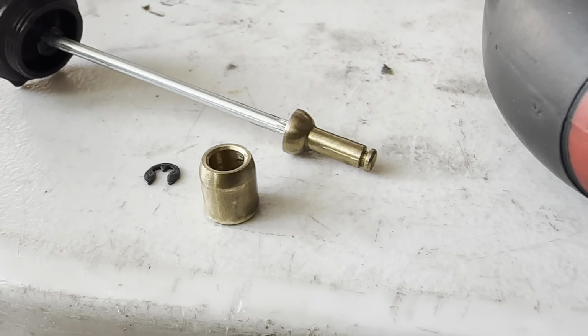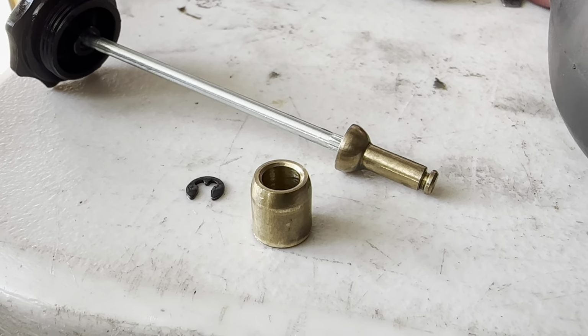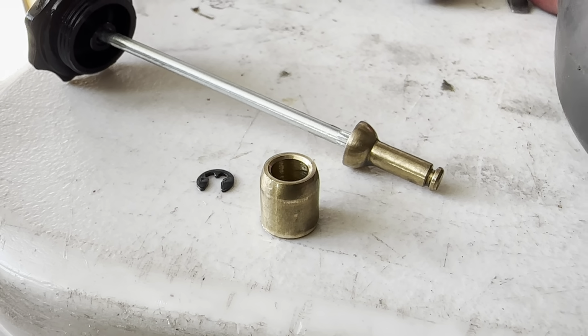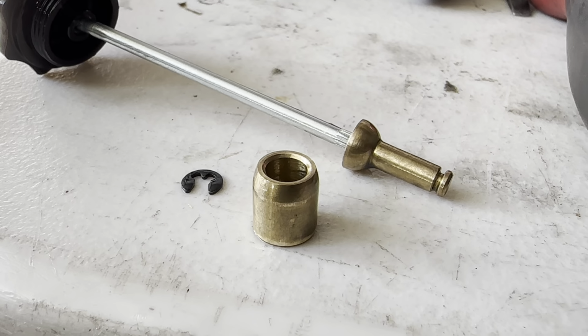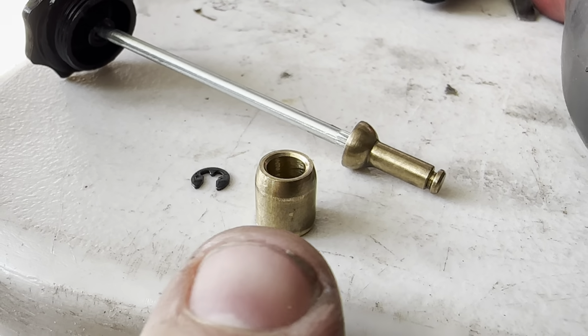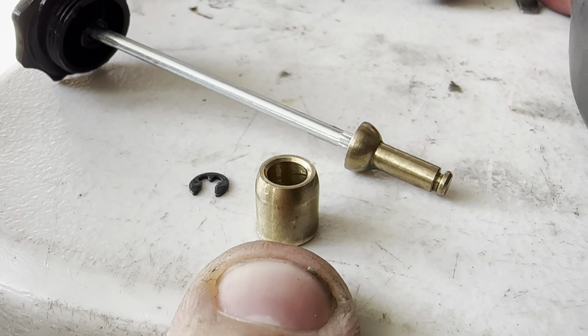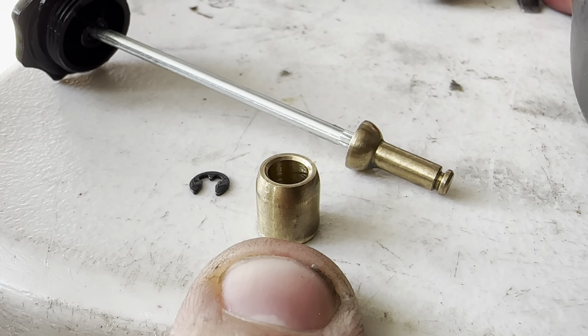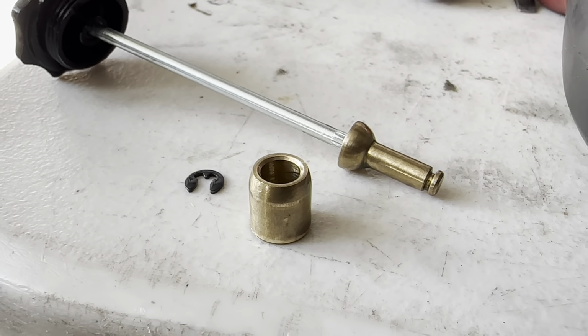Sometimes when tuning, it's necessary to get into the nitty-gritty of what's going on. In this case, no matter what I do, I can't get the oil or the piston slow enough on the rise. It's much too lean when you accelerate the engine. So what I'm going to do now is try and change the collar for a different one. Failing that, on this particular carb, I think we're going to have to make a custom-made one to get the enrichment that I need.